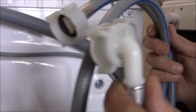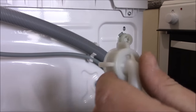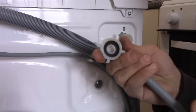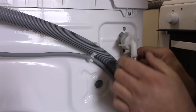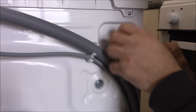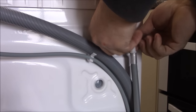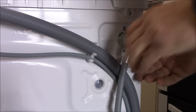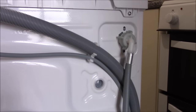That's the hose for the water supply. You see, we've got two ends — one is bent 90 degrees, one is just straight. To the washing machine I use the 90 degree bend. There's a thread here and at the end there's a washer inside, so you don't need any tool to connect it. Just tighten it with your hands as much as you can.